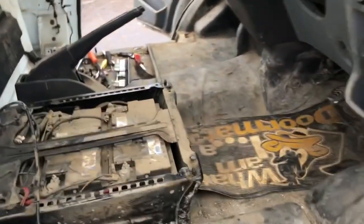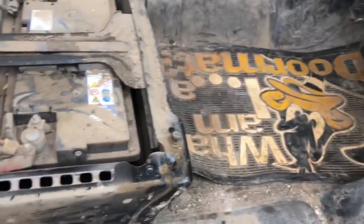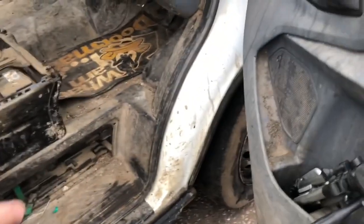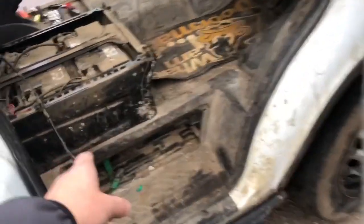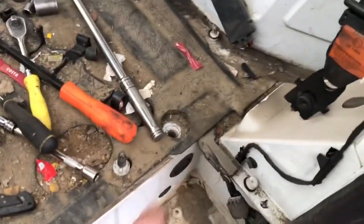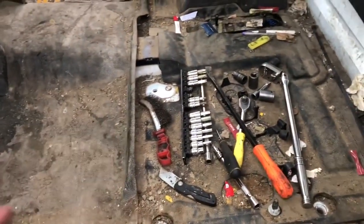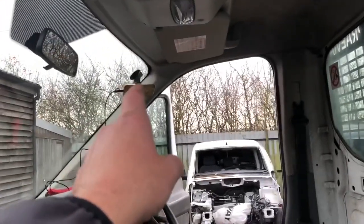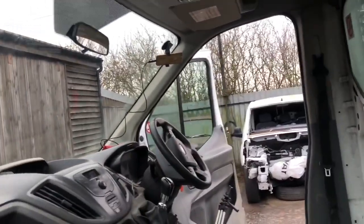It's quite quick to get the seat out - just four star drives from our side, and the occupancy sensor or seat airbag if it's got one is plugged in. I think it's just an occupancy sensor and that one comes straight out. It's a bit more difficult around Chris's side because we're trying to get the black mat out. That seat box doesn't need to come out because the black mat only comes up to the edge of it, but on the other side it actually goes underneath the kick plate and underneath that big seat box, so he's had to remove all of that. We're going to grab the vacuum out and get rid of all the loose stuff in here before we pull it all out.